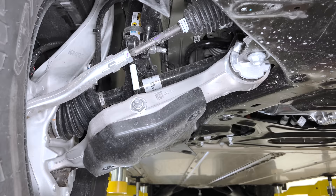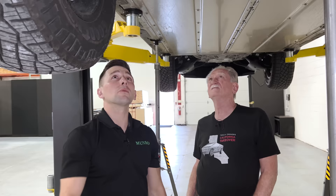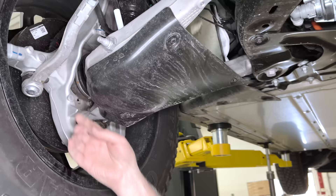In the world of corrosion and mud collection, you've got two schools of thought: one, keep it sealed out so nothing gets in there; two, open it up enough so that if something gets in, it can get back out. Right now I'm not seeing that — outside of a gap on the backside — and if it's proper mud such as clay, it's going to pack in there. The fact that it's bolted on versus wrapping around, I'll bet it's thermoformed.